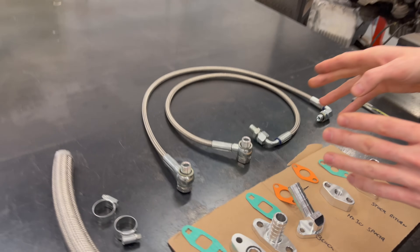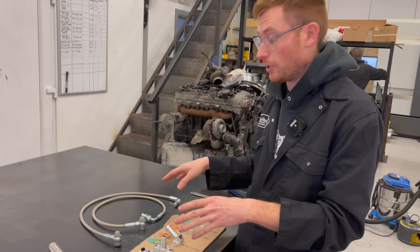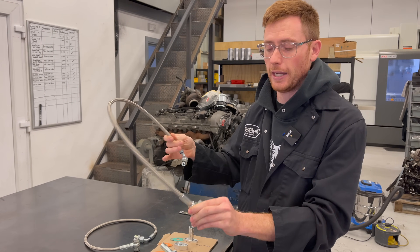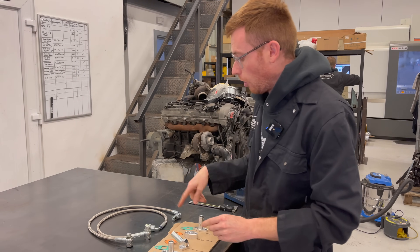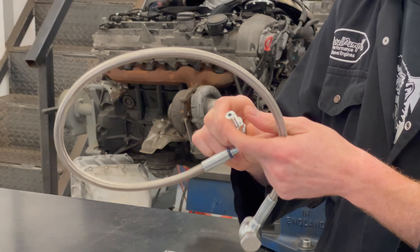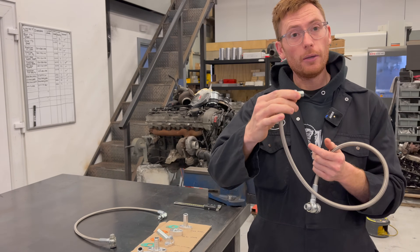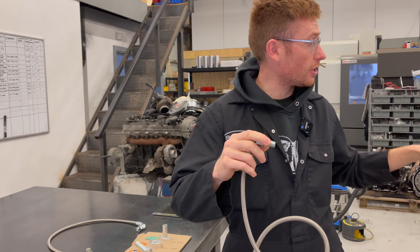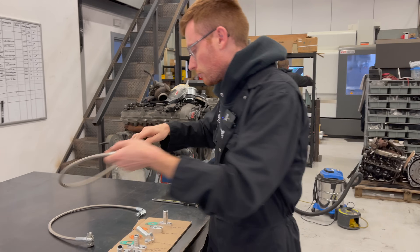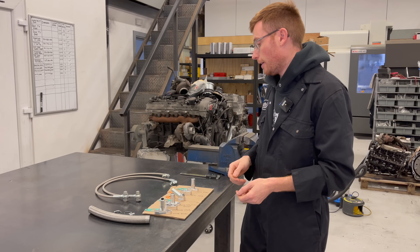The other thing is the turbo feed. We have two different types of turbo feed pipes: one for the Holsets and one for the Borg Warners. Fundamentally they're very similar — both are swaged hydraulic hose fittings because these are pressurized, and again stainless braided for heat protection. They have a different fitting on the end though: the Holset is a straight metric fitting with a dowty washer, the Borg Warner is a taper fitting which literally doesn't have a washer. I sometimes use a little pipe sealant on the Borg Warner — you don't want to use thread tape in there because if a tail of it goes into the oil system it'll go around all your bearings and oil pump. Just use a little bit of liquid sealant. The gaskets are included when we supply an oil feed and return kit.